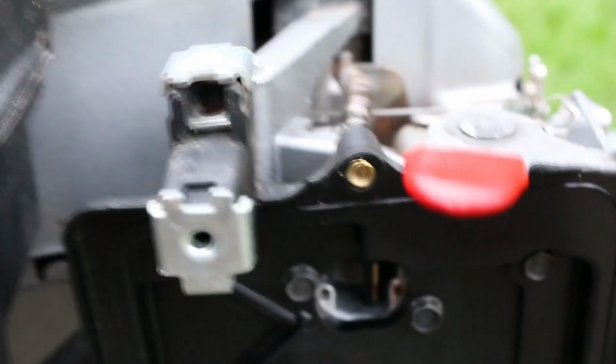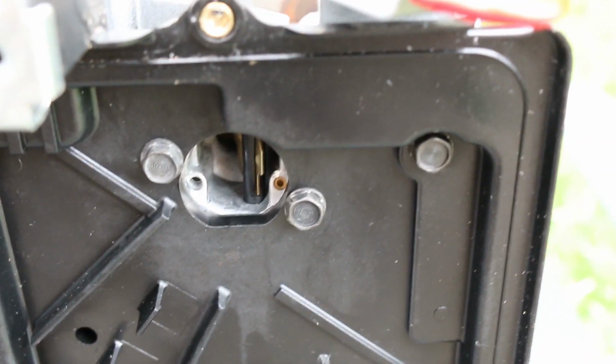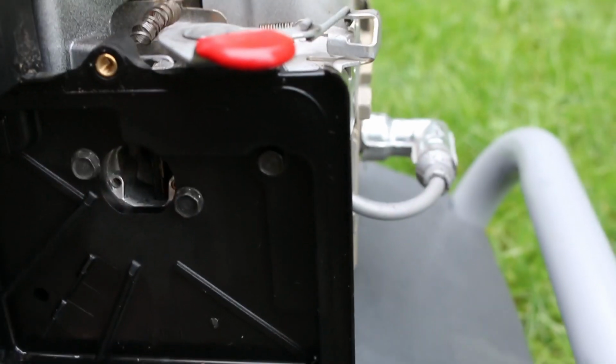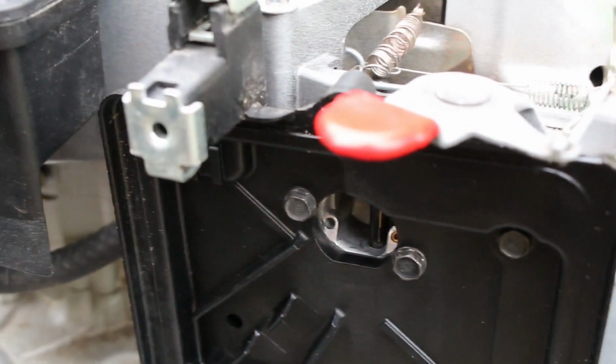Helps if you turn it on. Need two hands. Now the thermostat's pulled it off, so I think we're maybe good? I don't know. We'll see. In theory, that needs more tension to close that a little. Well, maybe not. I'm going to try it. We'll see. Nope. No dice. I think I'm going to have to get the right spring. But if I put a bit more tension on that, it'll start rich, but so be it.